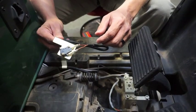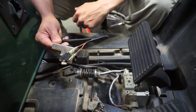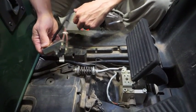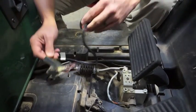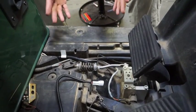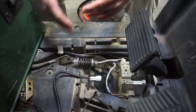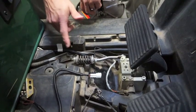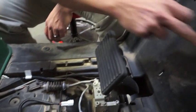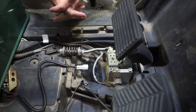In my hand we have the LGT161 brake switch for your RXV electric vehicle. We're going to go through the installation process. First, unpackage your LGT161 brake switch. We've taken off the rocker panel, removed the floor mat, rolled it back, and removed the access cover. To remove the access cover, there are plastic rivets that hold it down — use a proper tool so you won't cut or break them, so you can reuse them for reinstallation.